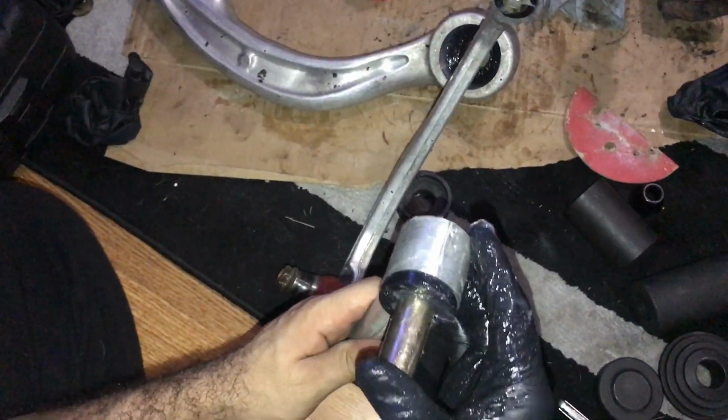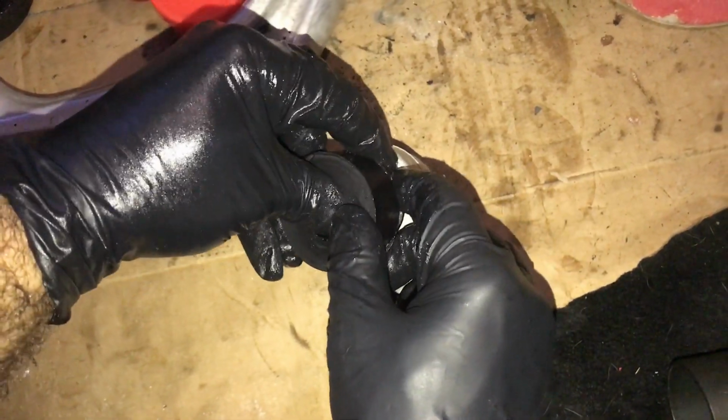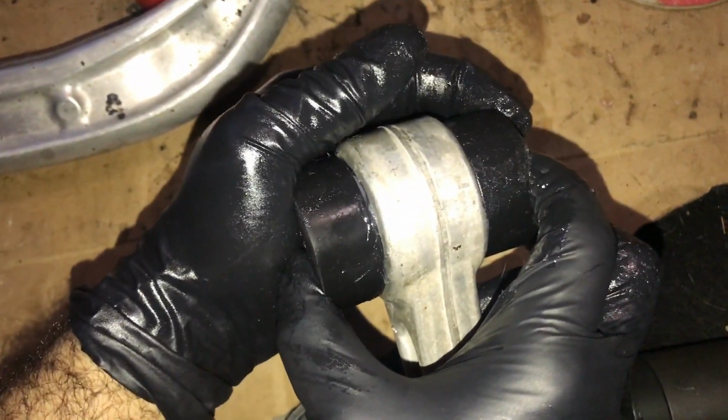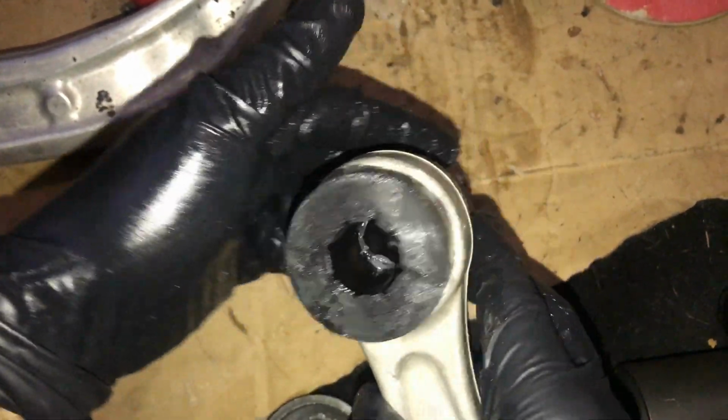All I can say is at this present moment, it worked out. What I can tell you right now is that I'll show you a clip. Some of them, the majority, 75% of the bushings, will be able to be pushed in because of the sticky grease. It'll allow you to push in all the bushings by hand. Yes, you do not need a press machine in order to make this work. Some you may have to clamp.